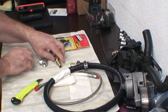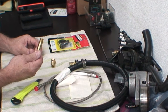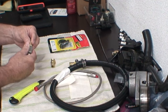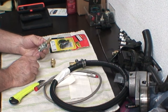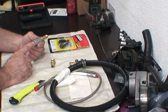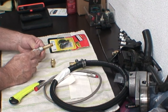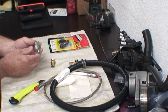Here are the fittings provided by ProCharger along with the hoses and oil feed line. This extension is kind of long, and it's supposed to go into the block, replacing the oil temperature sensor. The elbow fitting goes into the extension into the block. The problem is the oil temperature sensor is about as long as that extension, so putting all three together I'm barely going to have any room — it's going to hit up against the firewall. The only way to find out is to pull that oil temperature sensor out from underneath the car.